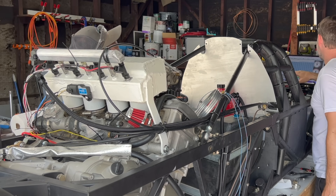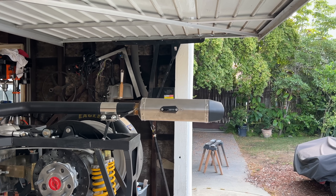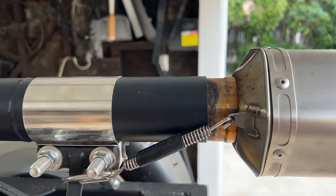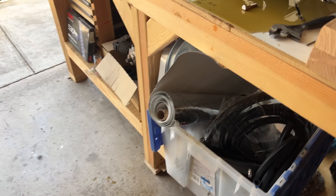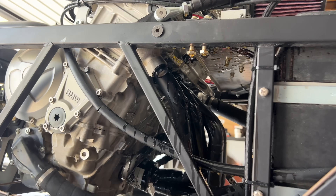For a few seconds. High five denied. Before we got too far, I decided that pissing off all my neighbors with an open pipe exhaust revving up was not a great idea. Fortunately, I had measured the Grom muffler and it was just the right size — it's supposed to slip over the exhaust, but this is a larger exhaust and it just happens to slip right inside the exhaust pipe. We had adjusted a lot of fuel into the engine, noticed that one of our base fuel settings was wrong, fixed that, and started over. Eventually it was running and would stay running and everything was looking great — until an oil line exploded. So we cleaned it up and took a lunch break.